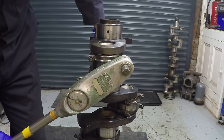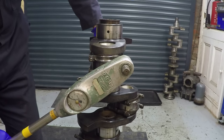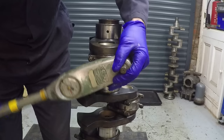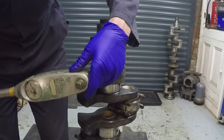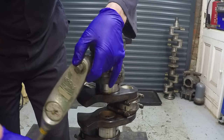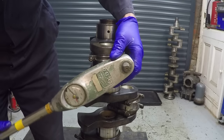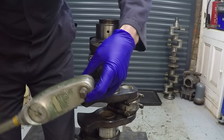You'll hopefully be able to see that as I keep pulling the torque wrench around, it's going to reach a point where the needle doesn't move any further, and that's supposed to be within the range of 25 to 35. I'm going to pull them up to 20 initially - just so we're not putting way more force on one bolt than the other three. Let's see what this one reads - that's about it there, okay, 25. Now the other one - a bit more than 25.